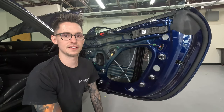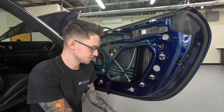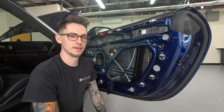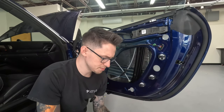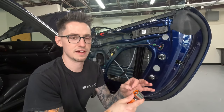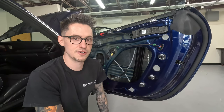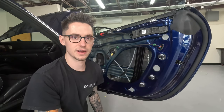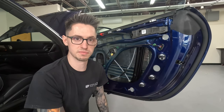One thing to note that I did not touch on before is utilizing a roller to install this constrained layer damper. The point of it is to help make sure you have full contact on the piece you're applying it to. Also, just a heads up about rollers, make sure you're using one with a flat surface, not one of the ones that have knurled surfaces or patterns in them. When you use a knurled roller or a patterned roller, you are stretching and deforming the aluminum constraining layer on your constrained layer damper.